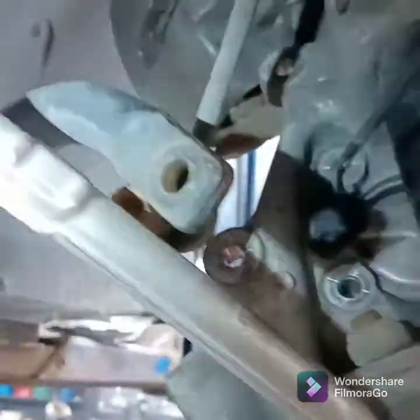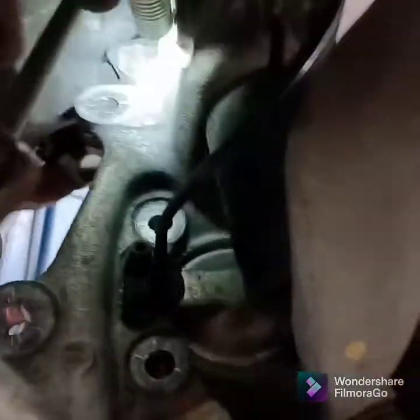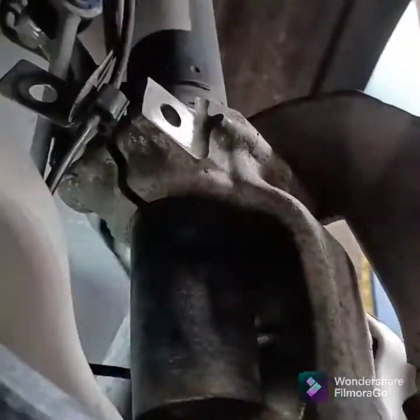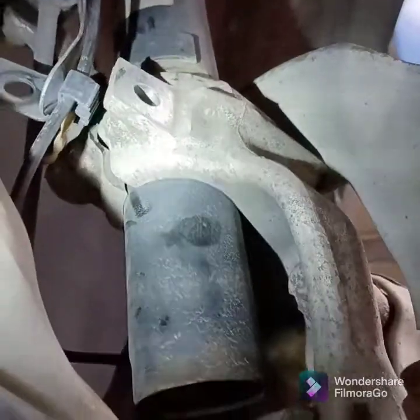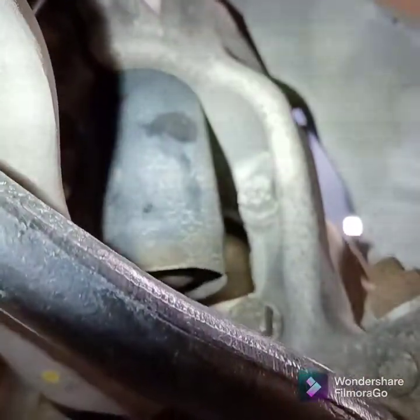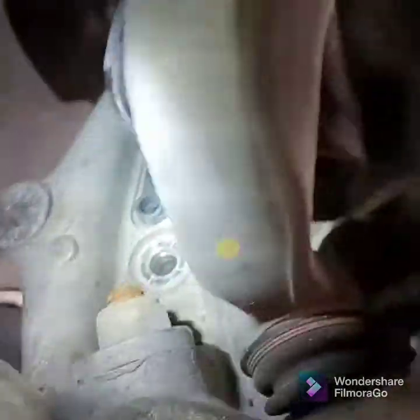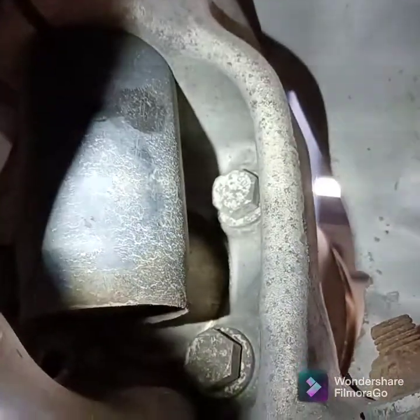What I did do though is the lower link on the sway bar. I ended up pulling that because that puts some tension on the, it holds the whole spindle upwards. So that's it. Now I'm gonna take those loose, put these other ones back in so I can kind of hammer on the back of the head a little bit. So that's it.